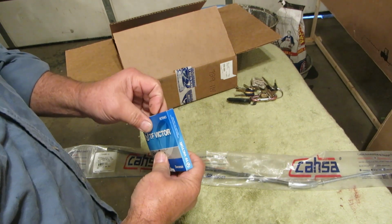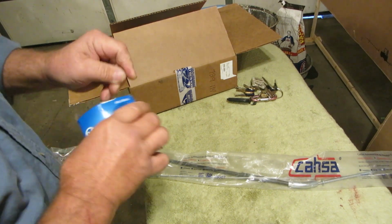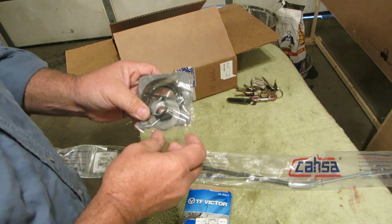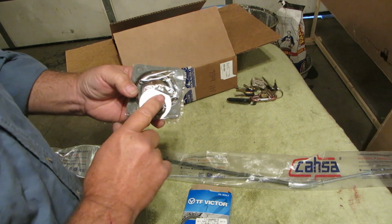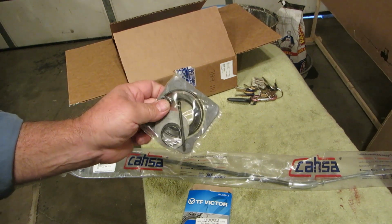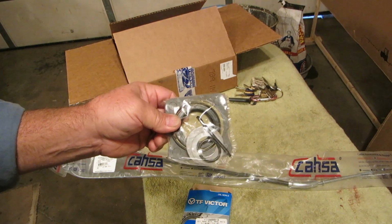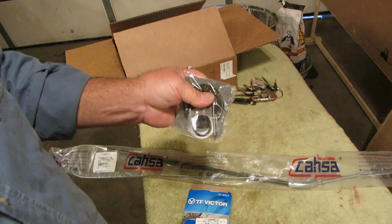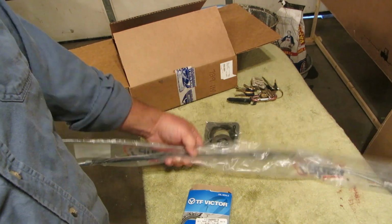While we're in there also, we're going to have a look at that other side. It's not leaking, but I did the other side the way I did the driver's side, that is the seals, and I want to look at that O-ring, because what I did is I used the original ring up against that seal, and the ring was all beat up and it tore that seal up, I think. So I need to look at that and make sure that's correct. I did not torque those bolts down to where they should be on the passenger side as well, nor the big nut on the wheel. So all that needs to be done. And I might as well do it while I'm in there putting the parking brake cable in.